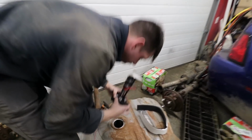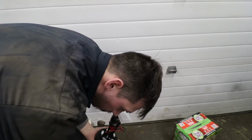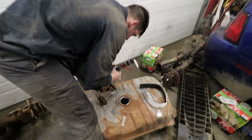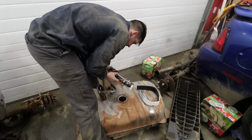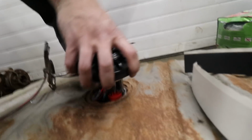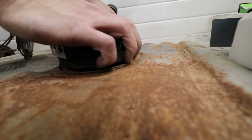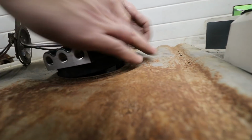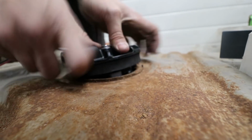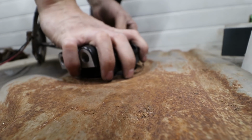So the diameter of this little inner ring right here is just too big for this ring. Yep. We could grind that. So down, Holley says sand down. It was a drop-in, but it's not quite. You can see when Kyle puts it in, it just ends up. So it'll require a little pressure? No. You're up by a little bit. Barely though.